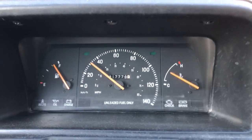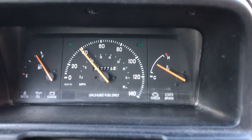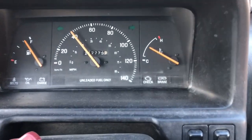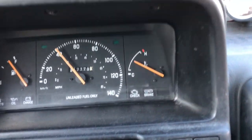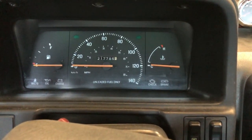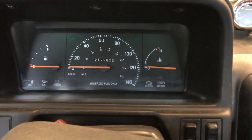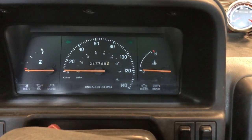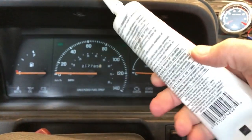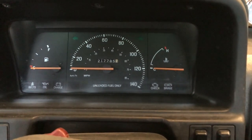Guess what? That is a fix. The speedometer head is quiet and it fluctuates maybe one kilometer per hour. I'm going to call that a fix. Frankly, I'm a little surprised that just lubing up that cable did it, because there was that noise right in the speedometer head. But clearly it was just a dirty cable. This product — the PTFE Lubricant, Motorcraft part number XG8 — is a very good product to use because it has the PTFE in it.